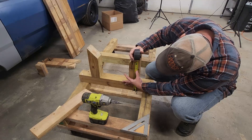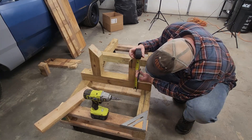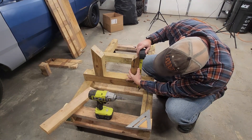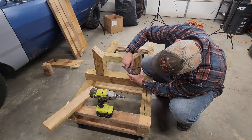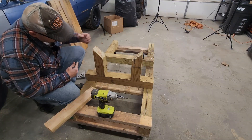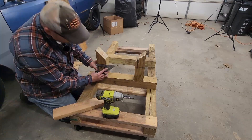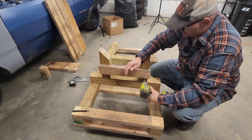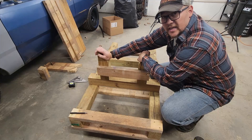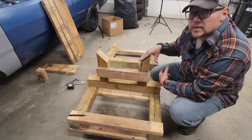Lastly, we want to cut them up — we'll call it eight and three-quarters inches. Come up and make a mark, eight and three-quarters inches from the bottom of the support 2x4. Draw a line on both sides. I put this cross member here just to help the supports bear the weight of the engine and keep them from splaying out since they're angled. This is a 40-degree angle, and it's actually meant to be used in conjunction with your motor mount brackets. And that's the base.